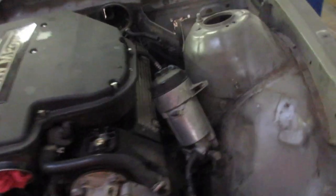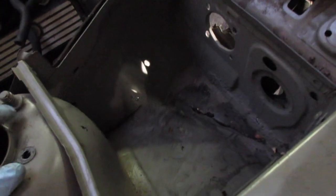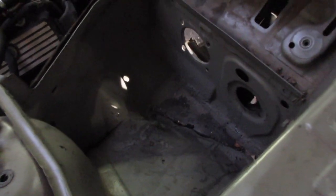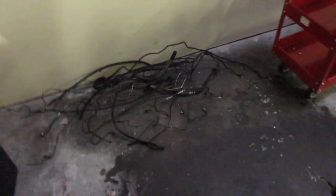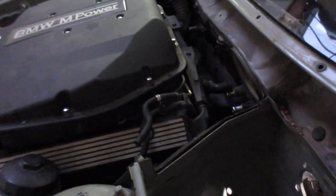The ABS module is gone, everything up there is cleared. The AC system needs to be evacuated ASAP and then we'll be able to take a lot more down. Off the brake booster - what an absolute pain, that was the first two or three hours today. All the brake lines are gone too - that also sucked. Most of them are sitting here. I had to cut them up, bend them, and pull them as hard as I could through their clips to get them out. But all steps towards engine removal.